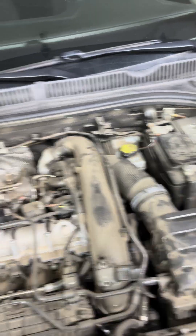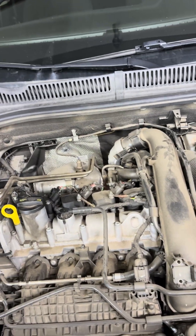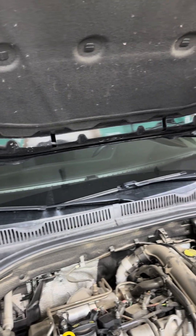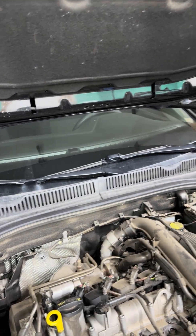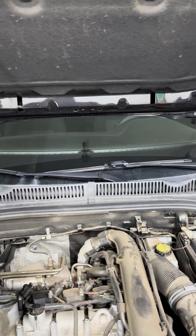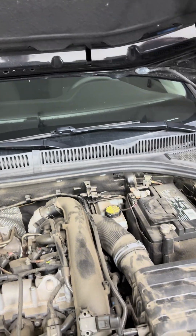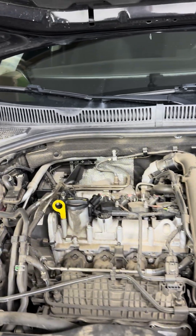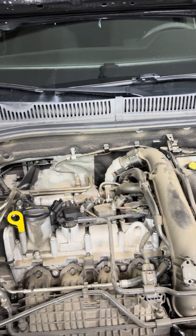The battery is what's actually powering up the entire car. Another way to find out is if you're driving and your battery light comes on. If that battery light comes on while you're driving, the alternator is also bad — or something in your electrical system is bad. However, nine times out of ten it's the alternator.